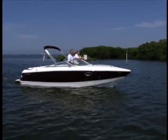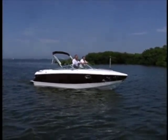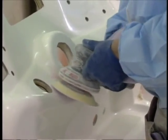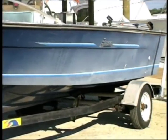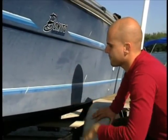But what happens whenever you do it that way is you're not only going to thin out the gel coat a little bit by sanding on it, but you're also going to expose pores in the gel coat to the open environment. That could lead to premature chalkiness or oxidation — where you take your hand, rub it up on the hull side and see that it's all white and chalky — or it could expose it to dirt and trap that dirt in.